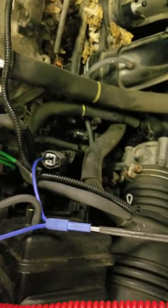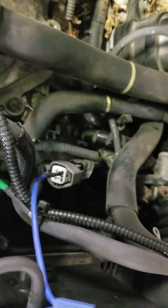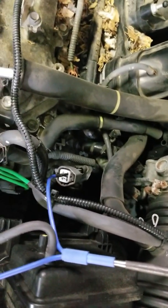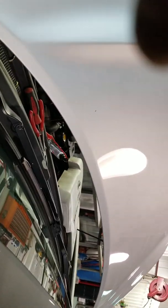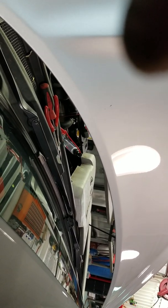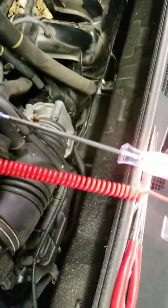I've got a front probe tied into the control side of the heater circuit on the harness side from the engine computer. The test light is hooked to battery positive. I'll go ahead and crank it — and you can see that control is there. The control side is good.